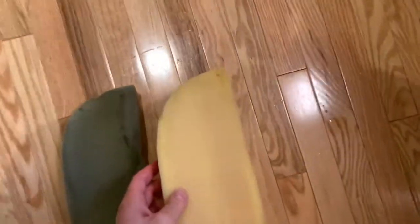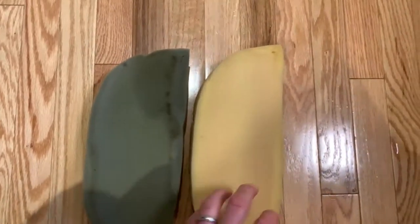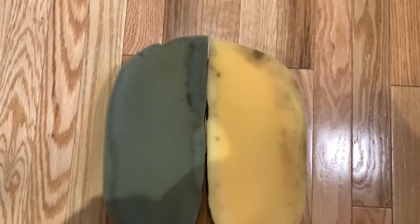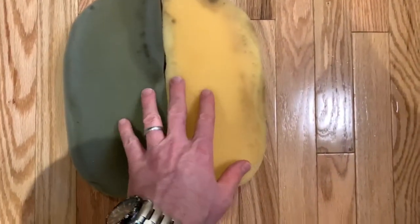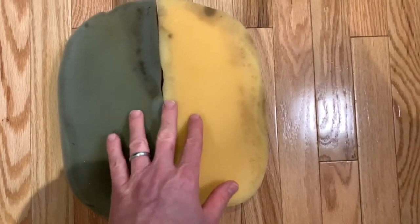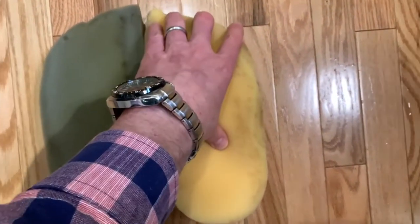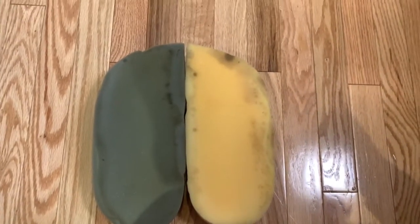We're going to go back and set it next to the other one. It was quite a bit smaller, and now you'll see they're the same size. I can use this as a template to cut out my new foam, and at least it will be approximately the right size — which is considerably bigger than the armrest itself and the fabric, because it's going to be compacted in the armrest. That's why it was shrunk. A little fun tip.